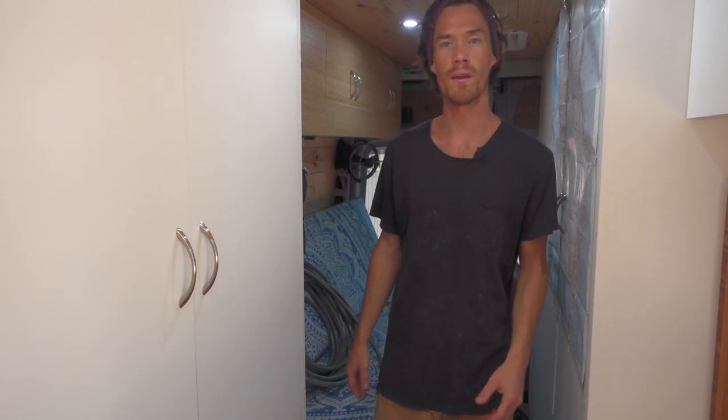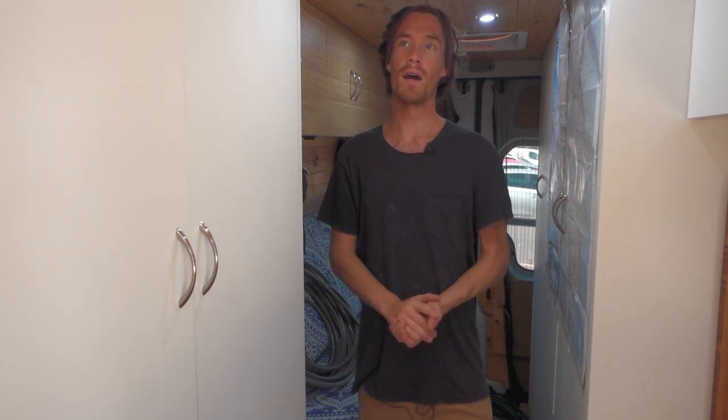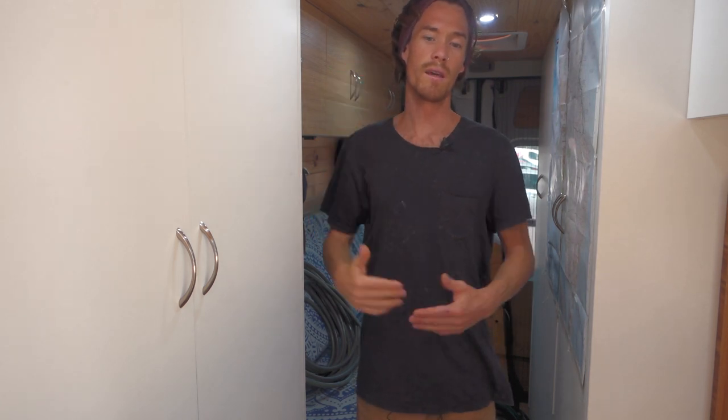In Australia there are tons of different parks and public areas that normally have a tap. I've got a little tap adapter that screws on to pretty much any tap in Australia, and I've also got one of those little brass four-way keys in case it doesn't have a handle on it so I can still use the tap. My fresh water tank holds 110 litres. Since being on the road we did have problems — the initial strapping I used to hold the fresh water tank up snapped and broke. Luckily it didn't happen while driving. It happened while filling up. I initially doubled the strapping but a couple weeks later another strap broke, so I reinforced it with unistrut and booker rods with 5mm 90-degree steel, bolting the booker rods through that and a unistrut to the bottom.